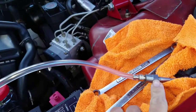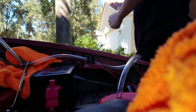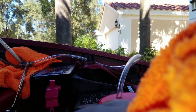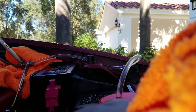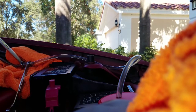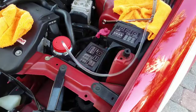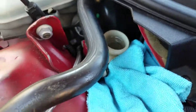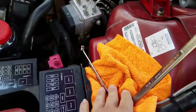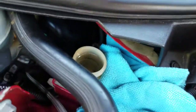It's going to be a 9/16ths and a 7/16ths wrench for those, if you had installed one of these yourself. What you want to do is give it about three solid pumps when you have the reservoir all the way topped off. Then go ahead and close this off after about three cycles of doing that, just to check the pressure and make sure everything is good. Do not let that run dry — you do not want air in the system.